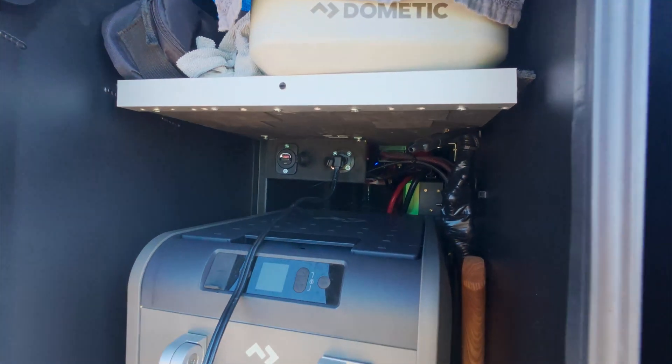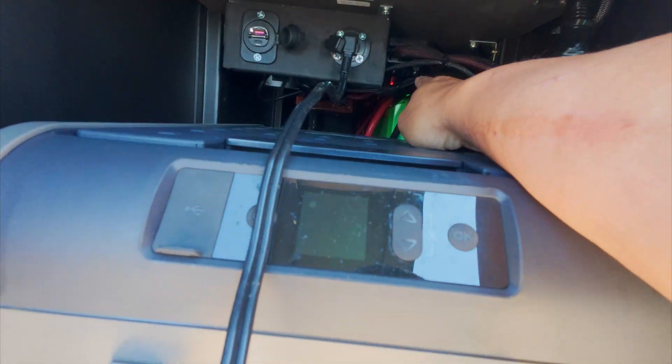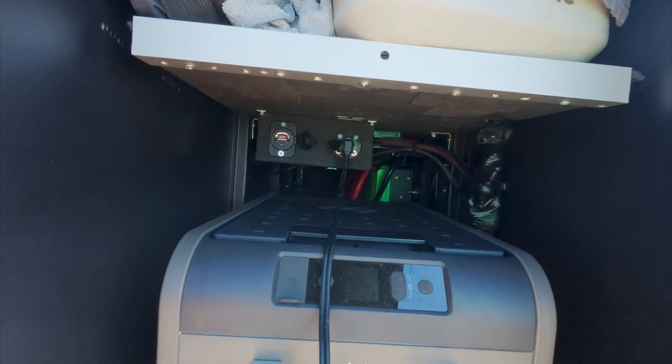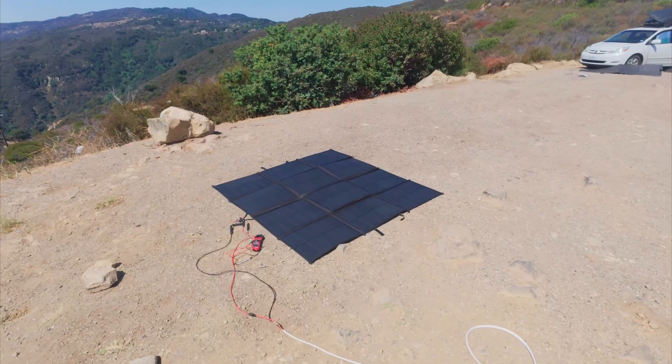This battery only normally charges via alternator. I have it plugged into the panel using the Redarc BC-DC Alpha 50, which handles both alternator charging up to 50 amps as well as solar input. At midday sun that's over 90% efficiency. So that's how you connect solar panels in series. The OptiSolX 440-watt solar blanket is one of the most compact I've ever seen, and it's especially cool that it's two 220-watt panels that zip together, letting you choose series or parallel depending on your situation.